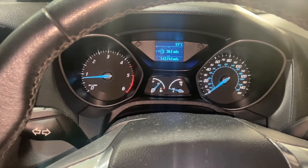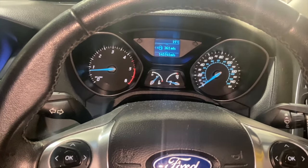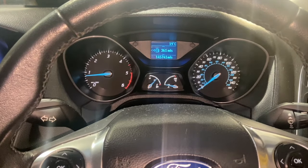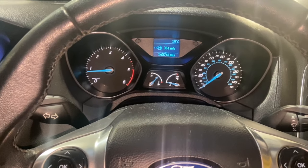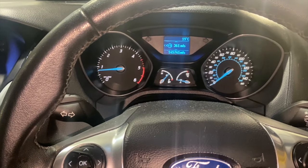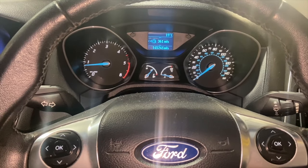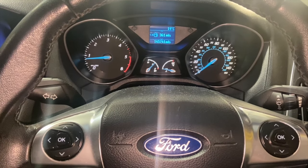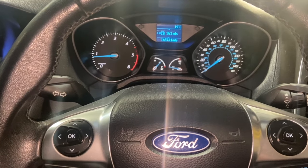See that started up — not too bad. If you don't prime the filter housing it'll take ages to start. All I'm going to do now is get out and have a good scan round: put it up in the air, make sure the sump plug is sealed up, make sure the filter housing is not leaking, check all around the fuel filter housing and just make sure that's nice and dry. Hope the video helped — if you liked it, give it a quick thumbs up and subscribe to the channel. Don't forget to check out the description below — there'll be links to all the tools used, all the parts, all the torque settings, capacities and any other info as well. Thanks for watching and we'll see you next time.